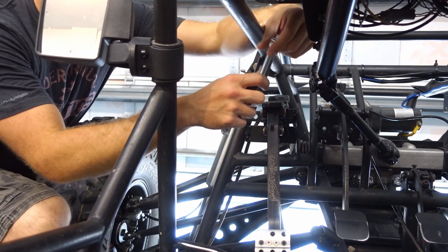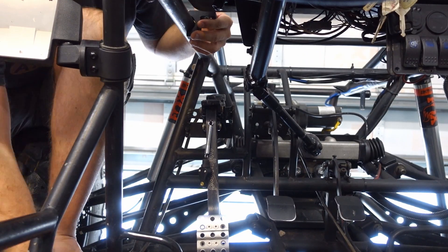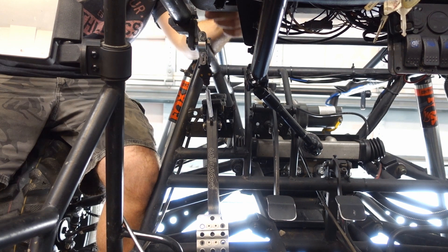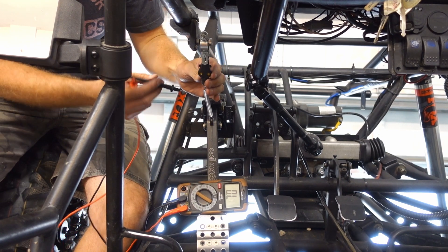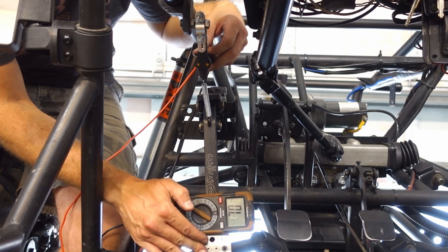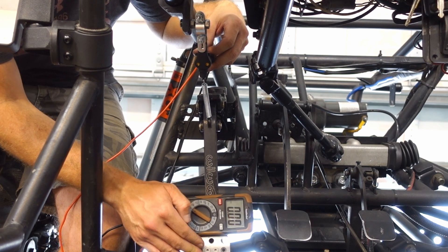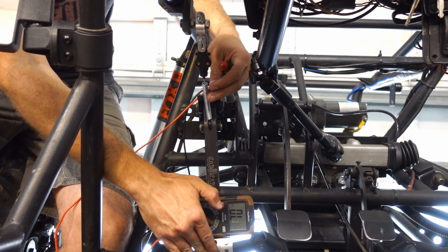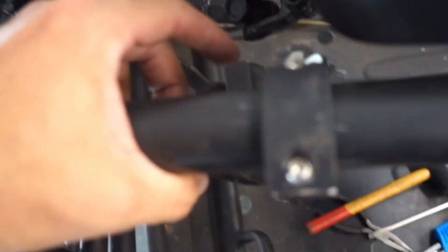Now for my setup, this is going to be really pretty easy. I am simply going to loop this through the clutch. Let's check our circuit here. Right now this should be set to open — yep, right now it's open. And we will gradually depress this. And now it's closed. Open. Closed. So just as I start to press the clutch there, it's closed. Open. That's about perfect. We just wanted a little bit of slack on that. Your mileage may vary. Now when we fully depress this, this shouldn't stretch the spring out too far. Not too bad. So this is all just a little temporary thing I've got in position here, just to make sure it works.